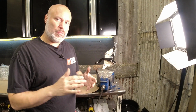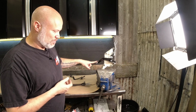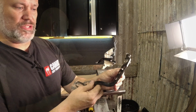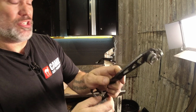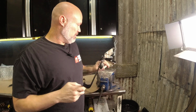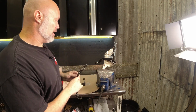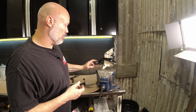So there were some comments online after we put up our intro video for this part. I had shown everybody the factory one. You push it down and then it kind of was creeping up. It wasn't coming all the way up, and that this one comes all the way up. This is just a cutout here. It's not a hard stop. You can see on the factory pedal, if this thing was resting up against here, there would be a wear mark on the top of here. These don't actually touch on most bikes. They're sitting down about a 1/4 inch, so it's not a matter of the factory pedal sitting here and not being able to be hyperextended, and ours being able to be hyperextended. That's not the situation, and I didn't do a very good job of explaining that in the intro video. I kind of overlooked that comment. So just be aware that this isn't supposed to sit against here on the factory pedal or with ours.